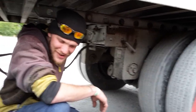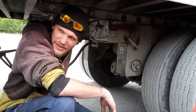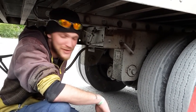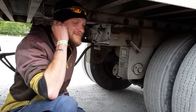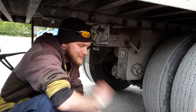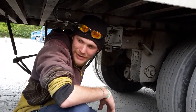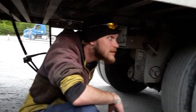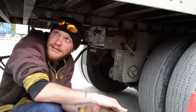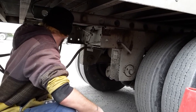Airlines are not hanging lower than 18 inches from the ground. It's technically 17 to 20, but anywhere in there is fine. No abrasions, bulges or cuts. Guys, did you hear that? Repeat that. Airlines no more than 18 inches above the ground. About 18 inches. Airlines, 17 to 20. The average standard is 18. Properly mounted, secure, no abrasions, bulges or cuts. Okay.